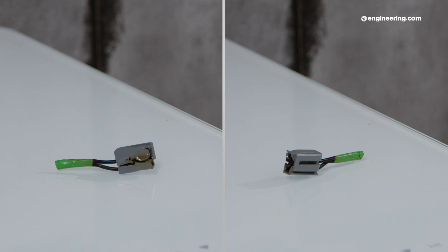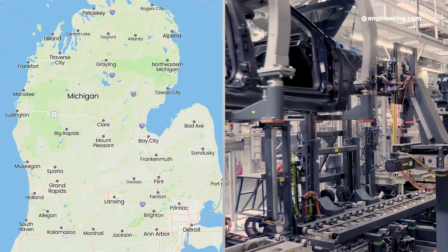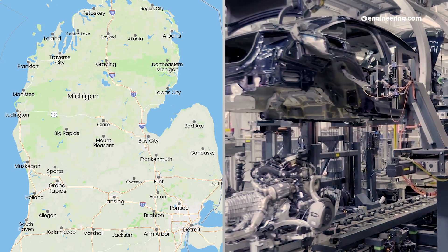Take a look at this. Now to those of you in the automotive, electrical, or electronics industry, you know what this is. It's a connector, but to me it's not just any connector. This particular connector represents a 75-mile auto club tow and a lost weekend. Why? Because this charred, melted chunk of resin sat midway in the power feed circuit to the in-tank electric fuel pump on my vehicle. What brand, you may ask? I'm actually not going to say, because my point is not about any one OEM — although this one was from a large Michigan-based automaker — but instead it's about things like this little connector and how they're engineered.